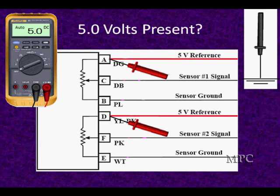When we go to checking them, we've all got to make sure we've got five volts present. Look for intermittent problems where you get into major failure modes. If you lose five-volt reference to both of these, we have no idea what the customer wants and the system is really going to go into a safety mode and start shutting down. But we're looking for five volts — scan tool or voltmeter, good way to check that.